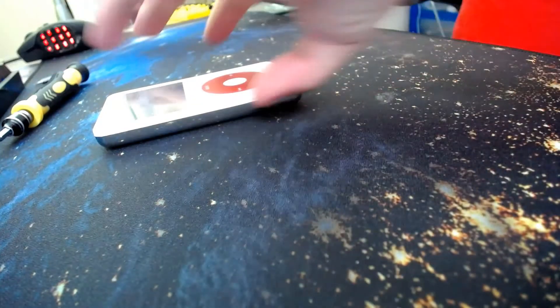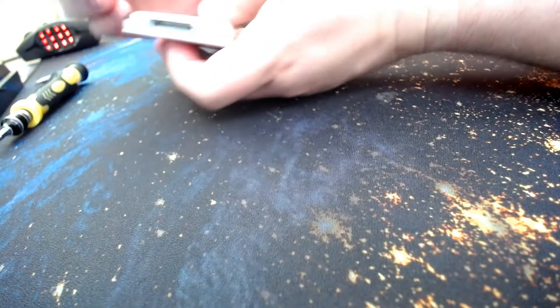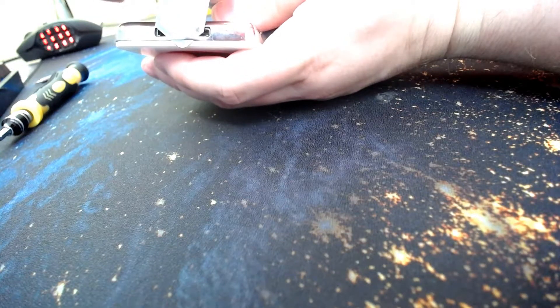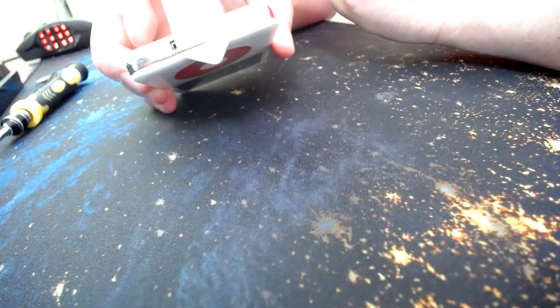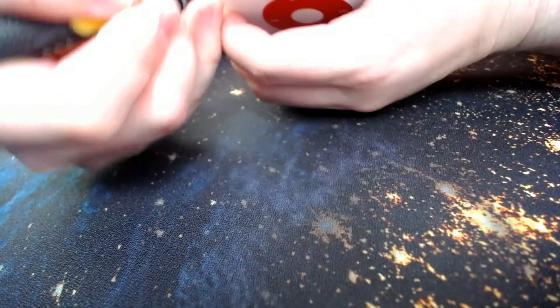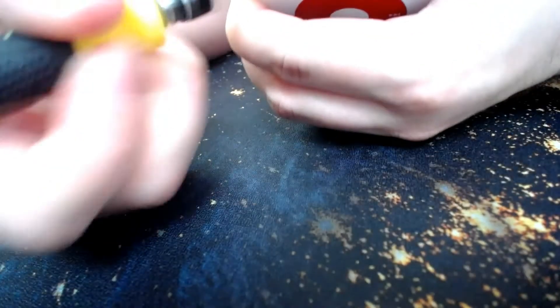So let's get started. You want the orange showing. Then it's kind of an odd trick — you've got to get in here right along the edge of the 30-pin connector and pull it out so that it goes all the way through. Once you get it through, you can start to get in with another tool such as the tiny flathead, and kind of start to work your way around the edge. You want to get along the edges here and you're going to see these plastic clips — it's going to pop those.